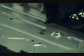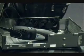So we're going to go ahead and grind those down with my Dremel tool. The way I do it, guys, is I use a stone grinder tool on the Dremel. It's just a little stone. I put it right on top of that ridge there, just like that, and then grind it. It's going to skip and jump and hop all over the place, but it eventually ends up getting down there. Alright, so now I've got these ground down to 3 millimeters.